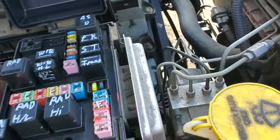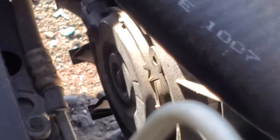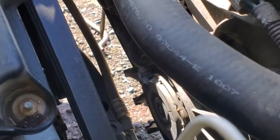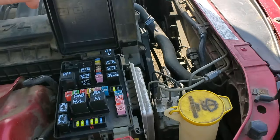One other step you can do at the fan itself — you can tap on the fan motor, you can try to turn the fan by hand and see if it's seized or not. You can also disconnect the electrical connector to the fan and see if you're getting a power and a ground. All of those steps may help you troubleshoot the cooling fans.